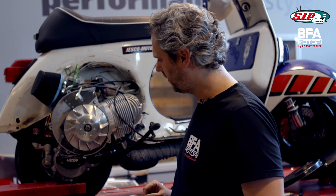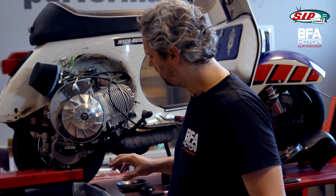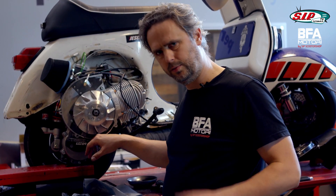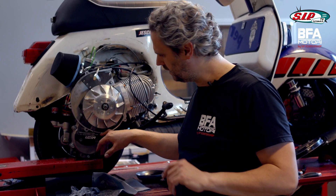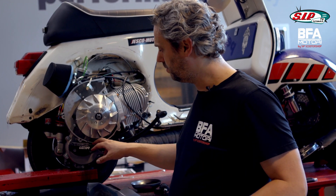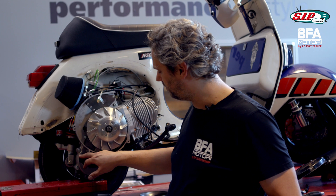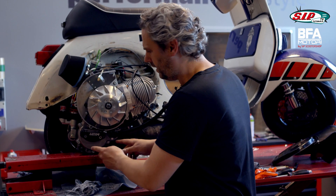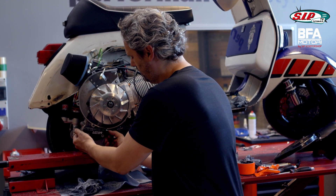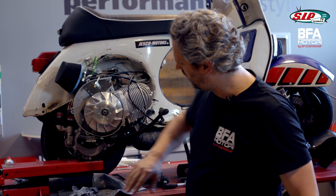What I would like to draw your attention to: the Lister selector box can be adjusted. It has five screws up here on the lever - two grub screws and three long screws - and with them you can easily adjust the lever. Make sure that the Lister selector box is really well adjusted when you install it. The whole thing works roughly for me now. I still want to adjust the spring force of the two pushrods so that it retracts evenly, but these are only small adjustments - otherwise, it works.